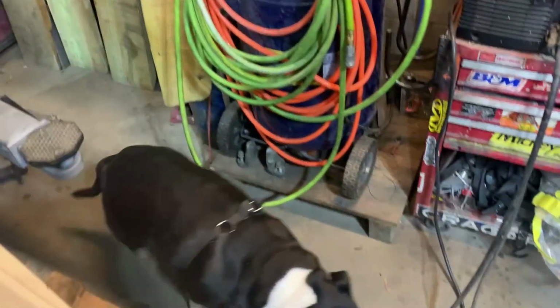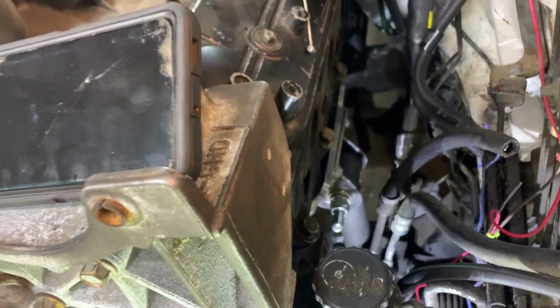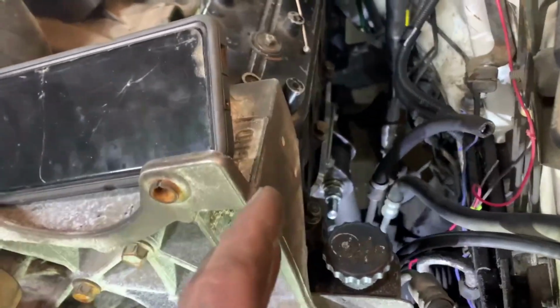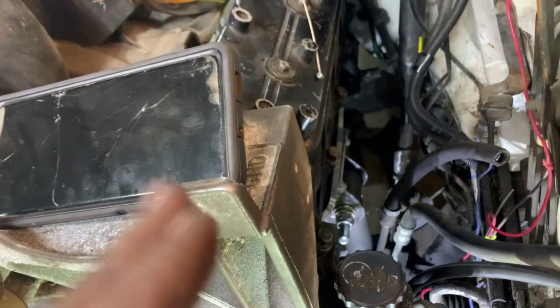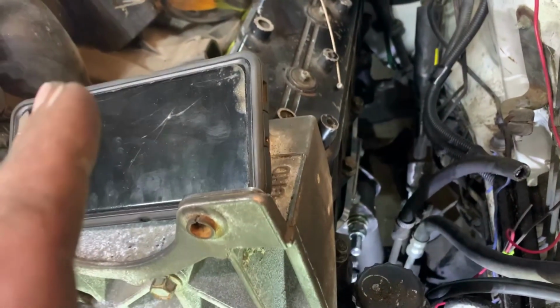Pocaroni sparkle in your day. Got the engine mounts about done. About to tack them in place where I could just unbolt them and take them out, and then finish weld them. But I'm gonna tack them just enough to pull the mounts out. And then the plan is to put a couple better tacks on there so I don't have to worry about it for the time being. Then I'll set it back down in and we'll go ahead and work on the transmission mount.